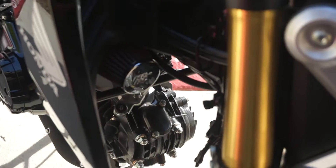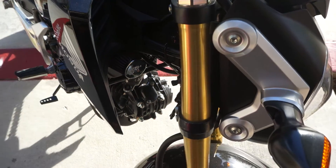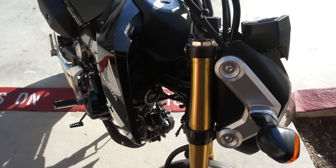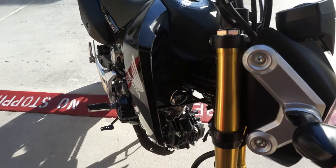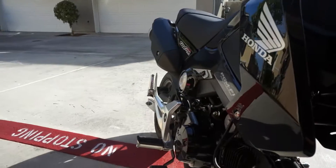As I go through my mods, you'll be able to get a good feel for what it sounds like. I personally like the Chimera intake — I feel a difference, especially in the torque, the torqueiness of the bike. But I also have a feeling that it's running a little lean. Last time I checked the plug, it was kind of white, and that's with the stock exhaust.